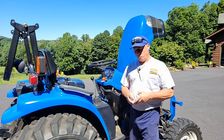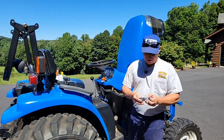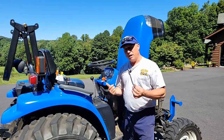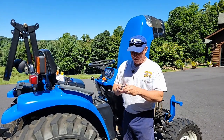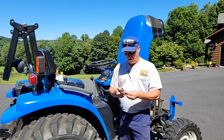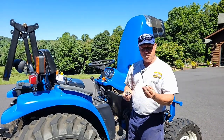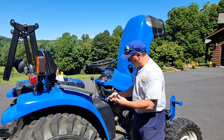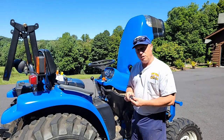This switch is held in with 1 nut. I'm going to show you on the new one. This is the switch. Remove your key. Bubba gets a new set of keys. Don't ask me why I call them Bubba. But right here, this is nothing more than a plastic nut. And if you have a 1 1/4 inch, or to say a 1 inch socket, it fits perfectly. So all I need to do is remove this plastic nut from the front of the ignition switch, and I can simply unplug the wire connector in the back, and this ignition switch will easily come out.